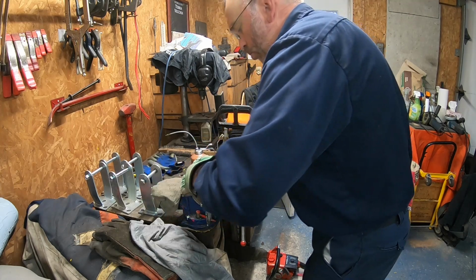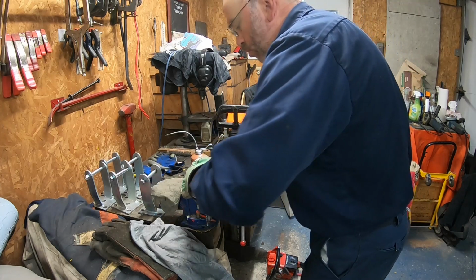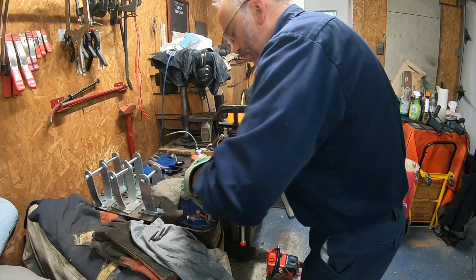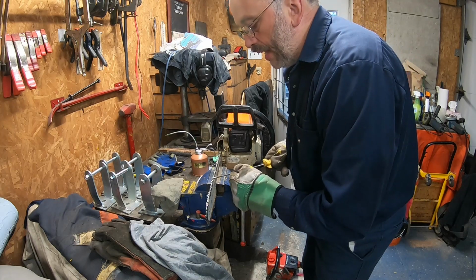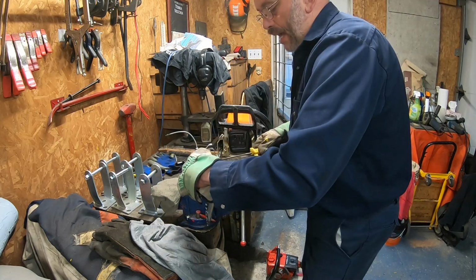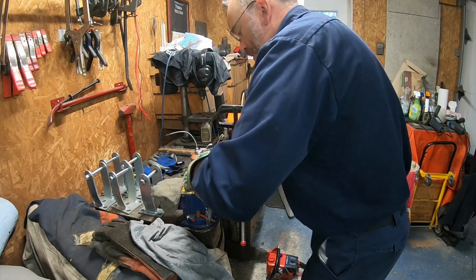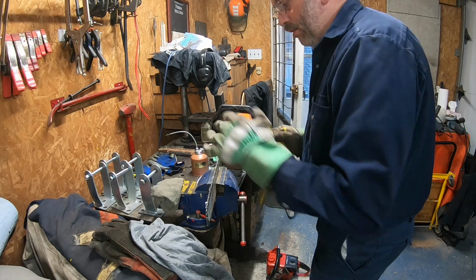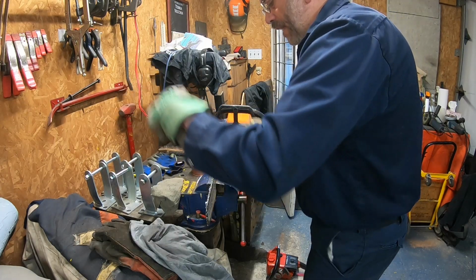And you make sure that both sides, the left side and the right side of the teeth, are equal. But you folks all know that. You can also look at the line. There's a line. That's your reference for which angle I'm filing my chain. But not moving your feet is the trick. Once your feet are well on the ground and you have the same posture, like the rocking, balance movement like this, you're in business.